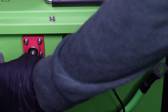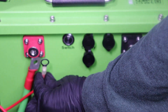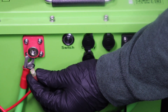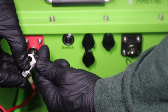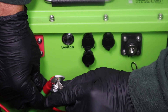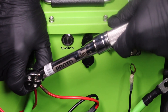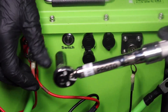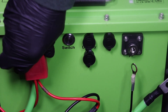Start with the positive side, going smallest to biggest, with the biggest touching the terminal. The smaller item is the yellow wire extended with red from the 12-volt reducer's input, followed by the red wire from the charger's output pigtail, and the last wire is the Bolt Energy main positive cable. Secure to the terminal and tighten the provided 13 millimeter hardware to 11 foot-pounds or 132 inch-pounds. Slide the positive terminal protector in place.